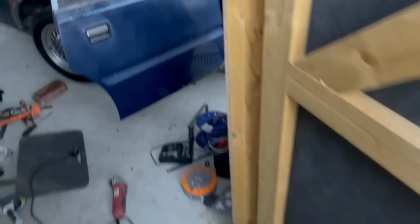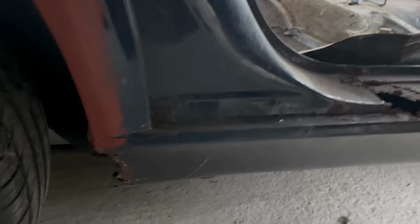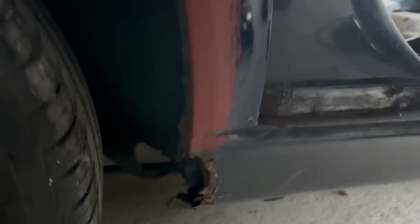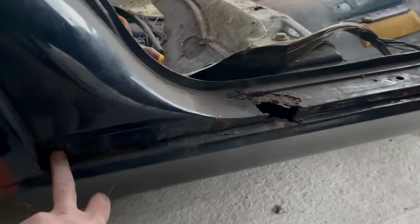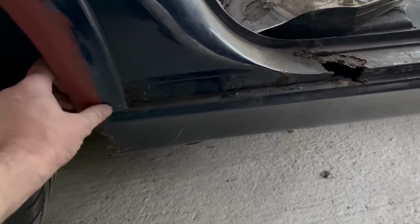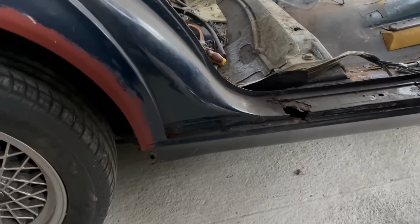And because I can't be bothered to do grinding now, I thought I'd do an initial investigation of this area. So I'm going to use a strip and clean disc to take the paint off the sill and the bottom of that wing and this area without damaging what metal I've got. I think there's more filler in here than I anticipated, which will be annoying, but that's what I'm going to do, and we shall see what the result is.